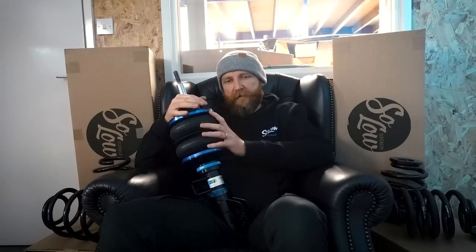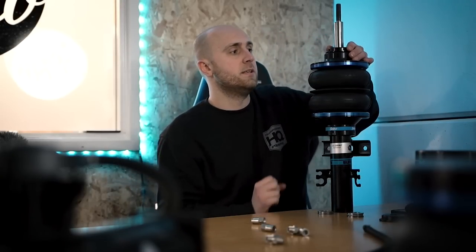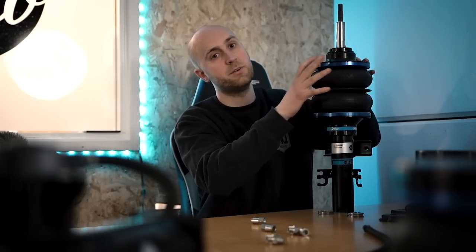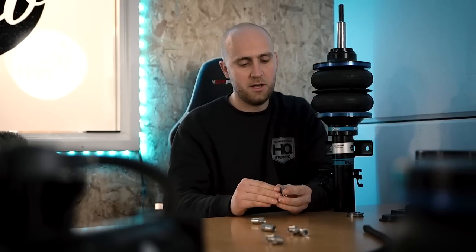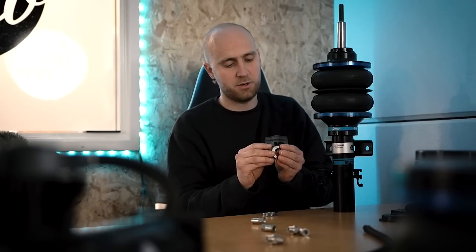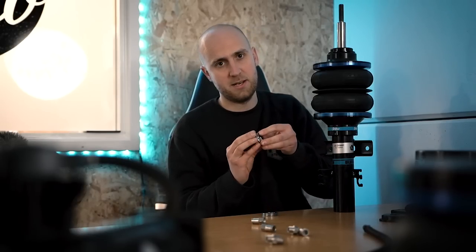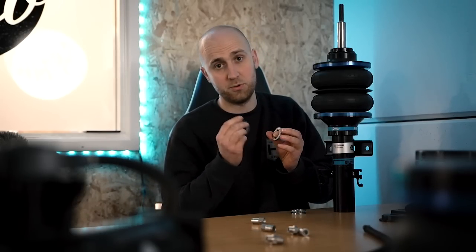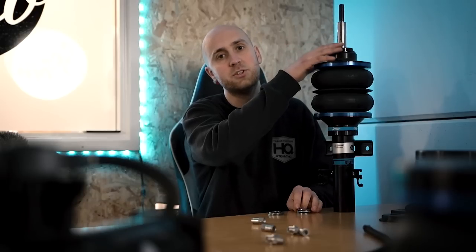Mikey has a complete T26/T28/T30 damper to run through top to bottom. At the top you have a top bearing — it doesn't look like one, but there's a needle bearing underneath. You only use the rubber top hat when going onto an air kit; you don't use any standard bearing. A lot of kits on the market use ball or roller thrust bearings, but we've gone for needle bearings. Needle bearings are stronger, spread the weight more, and are slimmer — so we gain lowness and get more meat in the top cap, making it stronger.